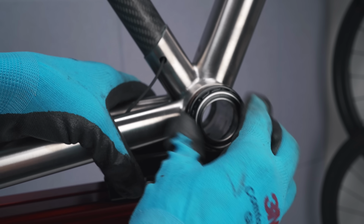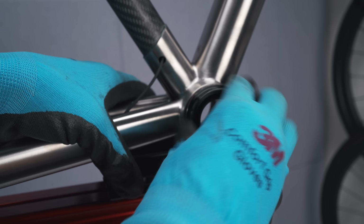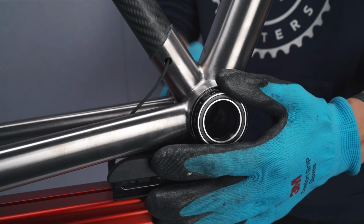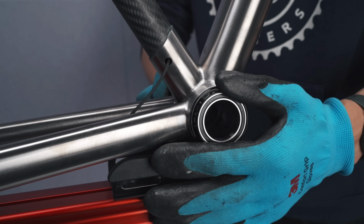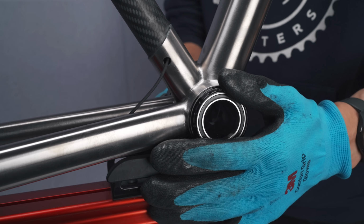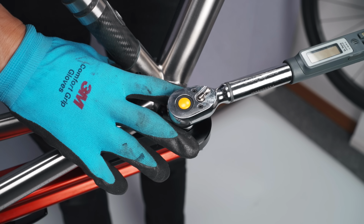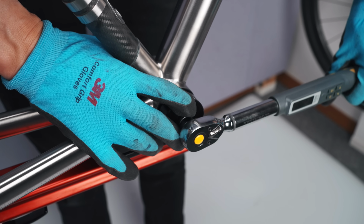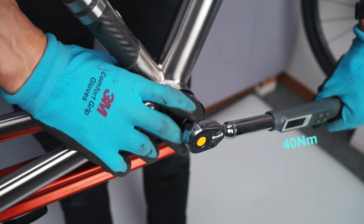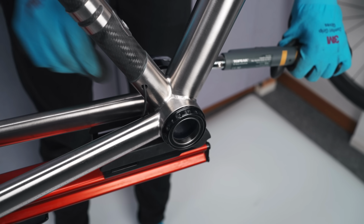Since copper paste has a tendency to just about get everywhere you don't want it to be, using a small brush to apply it is my tip of the day. The bottom bracket of choice for me is the THM T47 external bottom bracket. After living with the THM Clavicula crank for a couple of years now, using a few different bottom brackets, it's definitely the simplest to just go with the THM bottom brackets, as they seem to be slightly narrower than, say, a Chris King or a Token, for example. I will explain more on this as we get to the crank installation.